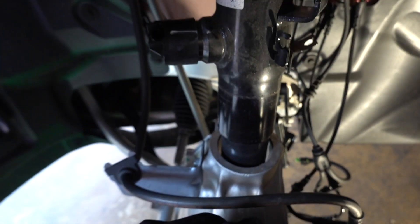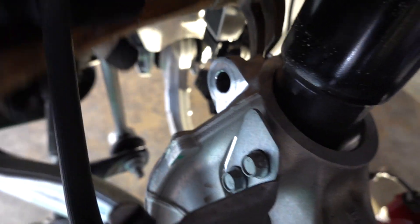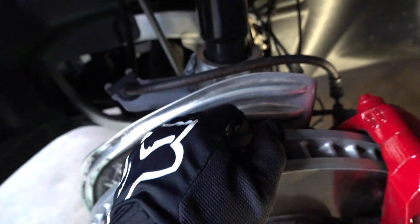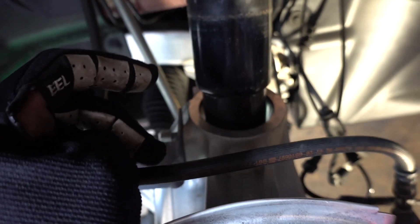I went ahead and took the nut off the sway bar — that comes off later. Next is the nut holding the actual strut end, using the same 16mm socket as the sway bar nut. Once you have all those nuts off, put a pry bar in — I used the side of a hammer — and pry on it while hitting the brake rotor down with a mallet. It pops right out of the sleeve. Then just unbolt the four screws at the top and it comes right out.